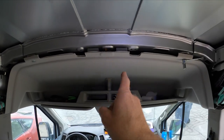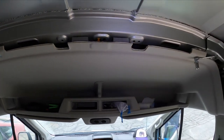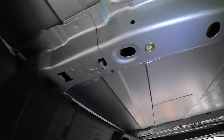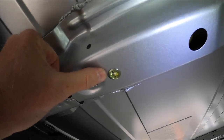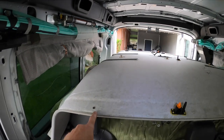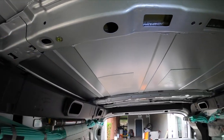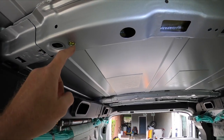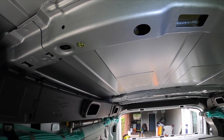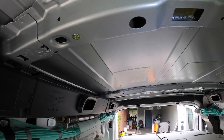I did not take off all of this because that's just a headache. What I'm doing is installing plus nuts or riv nuts right here, instead of the push pins that usually hold up the headliner. I'm doing that so I can eventually mount things. Eventually I may do a track of the 80-20 aluminum, or I might do an L-track or E-track, one of those random tracks.